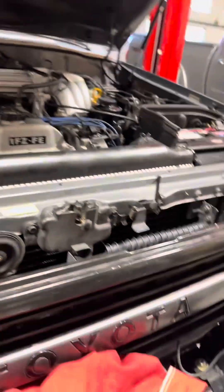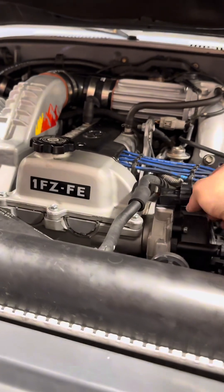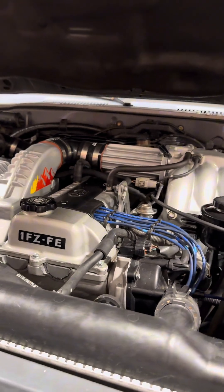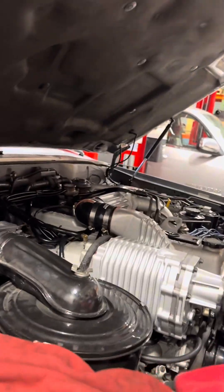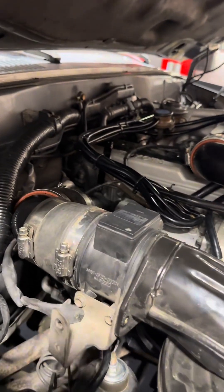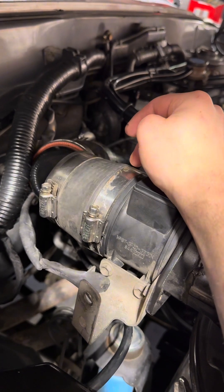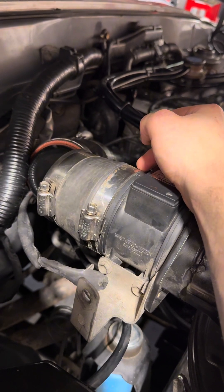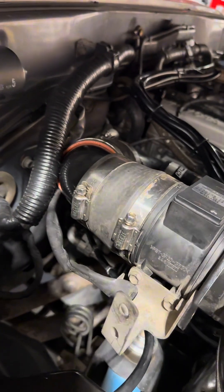Getting ready to start it. I'm going to reset timing — probably set it one degree lower at two degrees because I don't have 91 octane yet. There's a gas station literally about 100 feet away so I'll throw 91 in it. I have less than a half tank so it should be fine, or I could throw in some Royal Purple octane booster. The kit says this is a 3.5-inch to 3-inch hose but it's more like 3.25 inches — the 3-inch had way too much slack — so I went with the one that came with the kit and I'll order the HPS one to swap in.